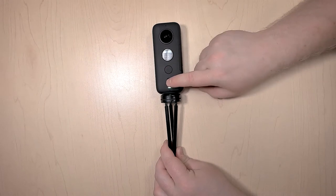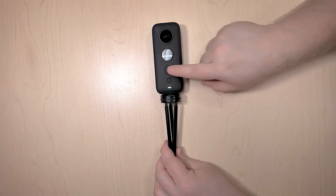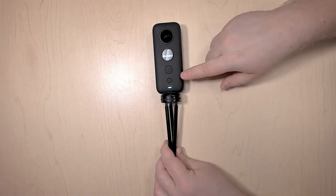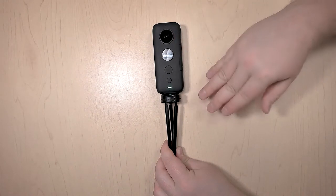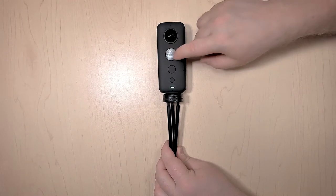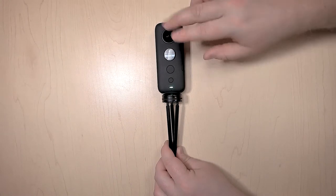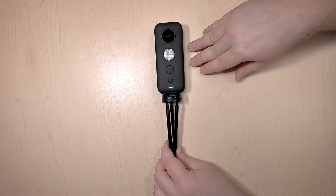In the About area, scroll down until you see Format. When you click the big button and go into Format, you'll see a checkbox. When you hit the checkbox, it's going to totally remove all the files from the camera and they will not be retrievable. It'll just look like the screen froze for a moment—if that's what happens, it means it's working properly and all of your files are getting removed.